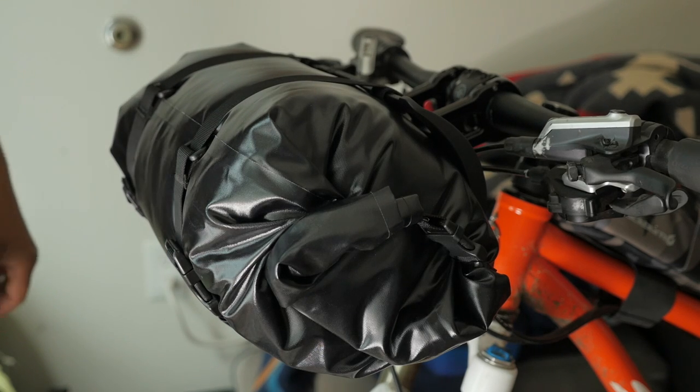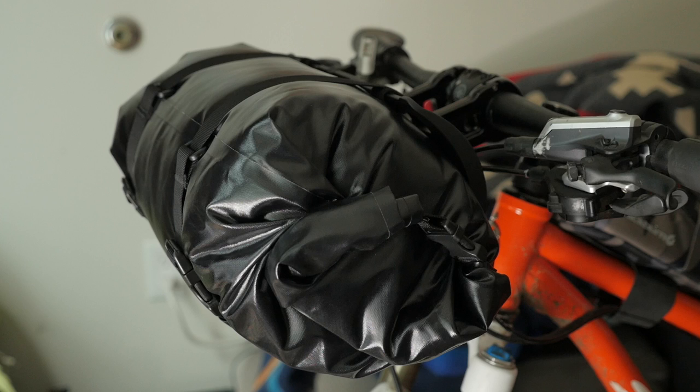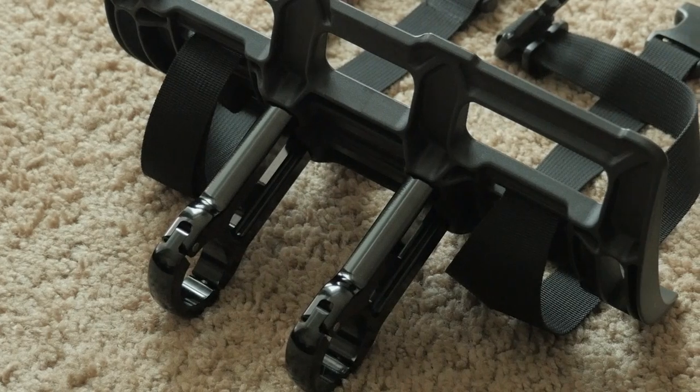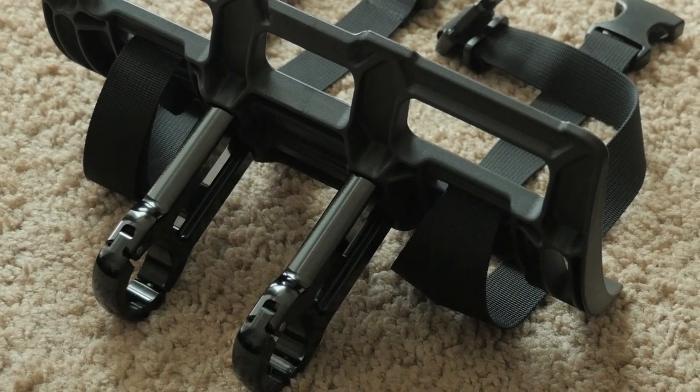One thing to note about mounting: they recommend tilting the arms down, which brings the load a little closer into the bike so you don't have a big weight cantilevered out front affecting your steering. If there are any drawbacks, if you're a super weight weenie, then weight might be a factor. Another potential downside is that although this hardware is a lot beefier than what was included with the Blackburn, it's still hardware — the plastic could crack, something could happen to the aluminum mount — so there is still potential for failure that you wouldn't get with a completely soft mounting system. That said, looking at and handling the mounts, they look really beefy and burly and it's going to take a lot to break these things.